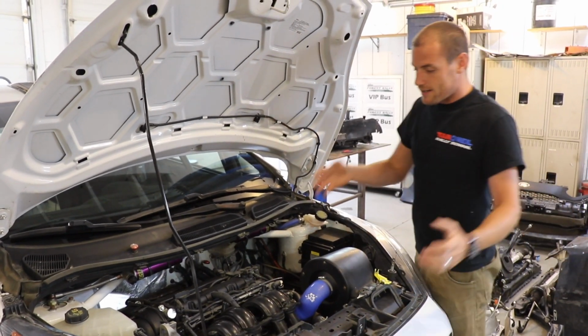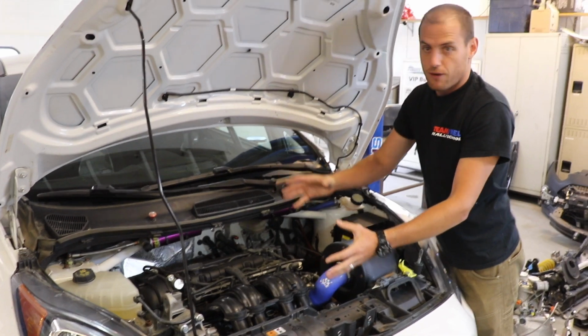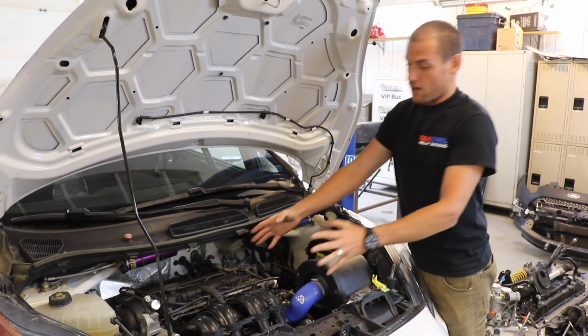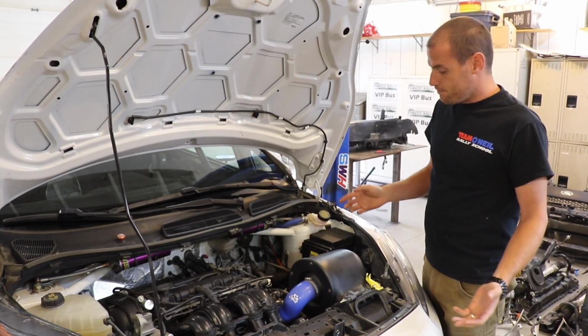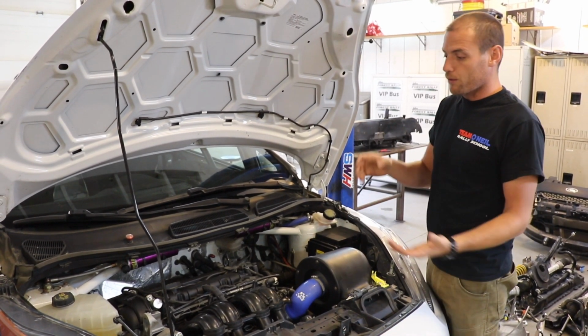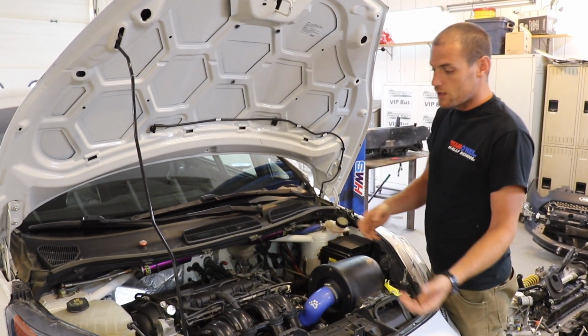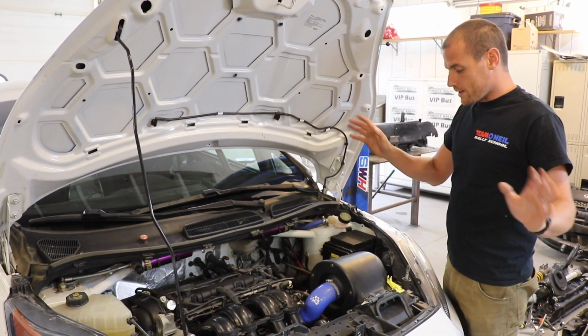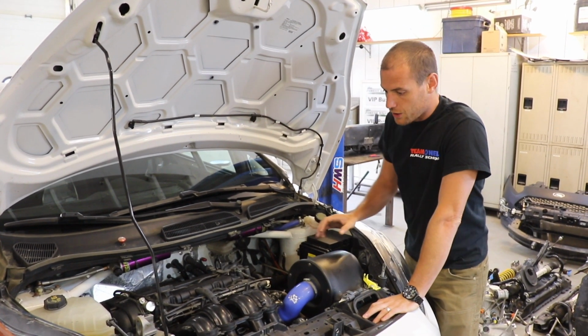Breaking an engine mount, essentially what happens is your engine, and transmission in this case, comes free from the body at one mount or another, and this whole thing starts moving around, and it's going to have a bad time, really. It's going to pull a fuel line off and cause a fire. It's going to pull some other lines off and cause the engine to stop or overheat, or who knows what. It's a bad day. Do really good engine mounting where you can, and you're good to go.